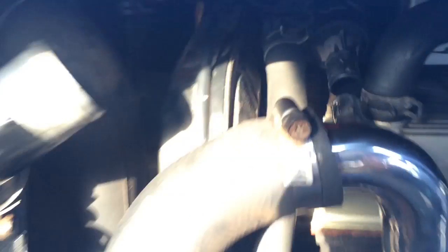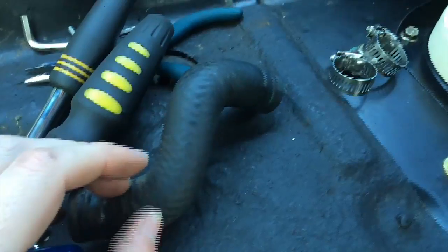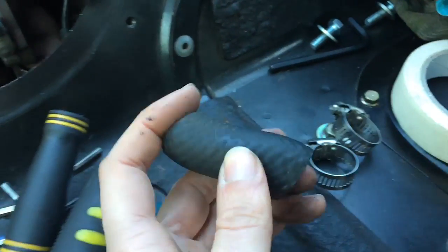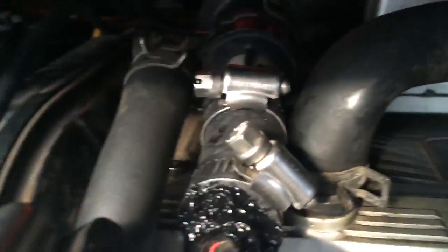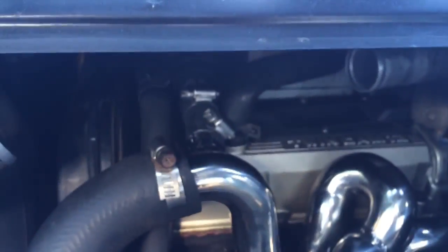Alright, cutting these - I'm using the 13 millimeter and I only need a little tiny bit just to fit over this. I had to remove the intercooler hose again, but I'll put it back on - it should be really fast. And just as I'd hoped, fits on pretty good, it's pretty snug. That should make up the difference. All I need of this is about two inches of straight pipe, so I'll just take out the bends and use that. That's pretty much all you need - it's about two inches. I got some new hose clamps too, so I can tighten it down as tight as I want. I used a whole bunch of silicone seal just in case, because I don't really want it coming off. It's been kind of cool just finding ways to be creative and make cool stuff work.